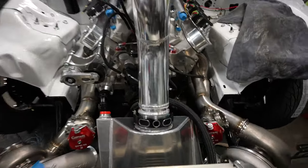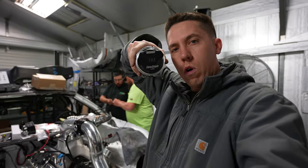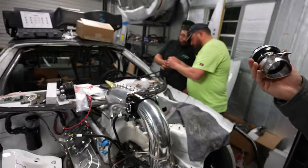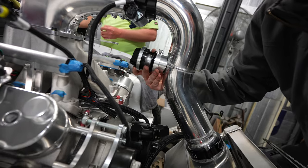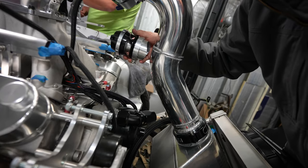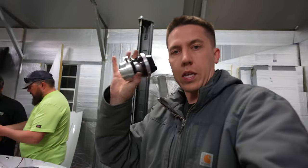The intake tube is all welded up all the way around. Now I'm going to install the blow-off valve. I actually got a ProPort from TurboSmart — this thing flows quite a bit more than the race port. I think one of these is good to like 3,200 horsepower so I can run one. I'm going to mark out the spot on the seam, draw around it, cut a hole, fit it up, and weld it in there. The blow-off valve mount is all on there and good to go.